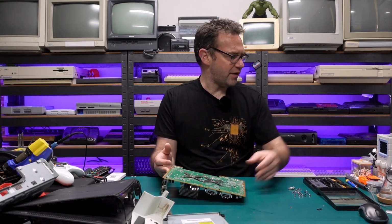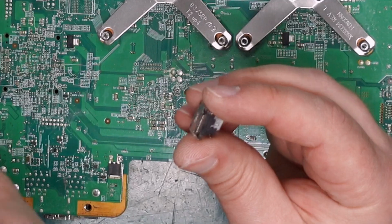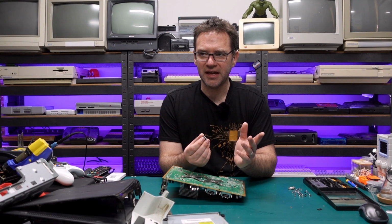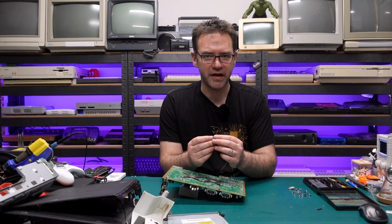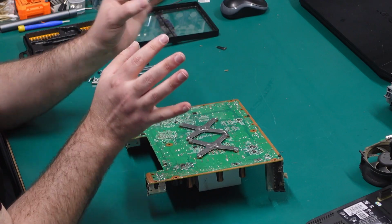So I do have a spare one here. I actually stole this off the Xbox 360 that I modded a few months back. Yeah, that one eventually died. And when I took it back to stock, I found that it had a 0022 red ring error, which I think is a failure in the CPU. So no hope for that one, but there is hope for this machine.